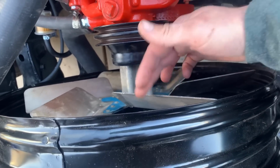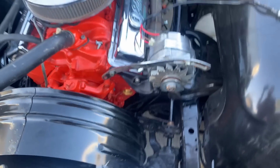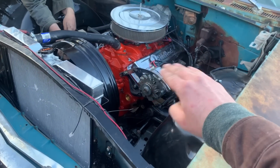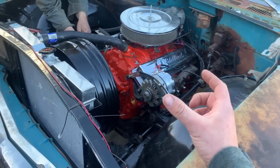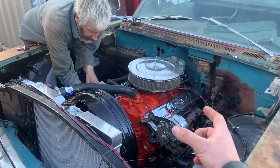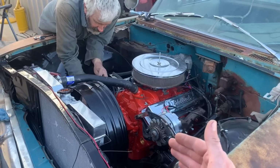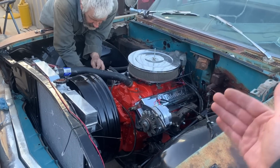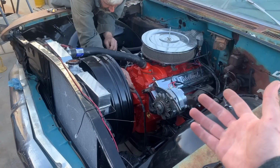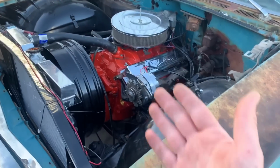Perfect, absolutely perfect. Now we can go ahead and put the belt on, and with the engine being 2 inches down and 2 inches back, remember in the last video, the first start of the video, we had to shorten the drive shaft an inch, exactly. That was for the old motor mount. Since the motor is back further, we have to recut the drive shaft another probably 2 inches so that it'll fit these new motor mounts.